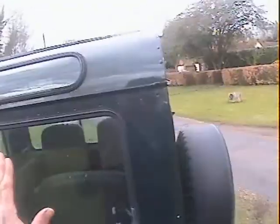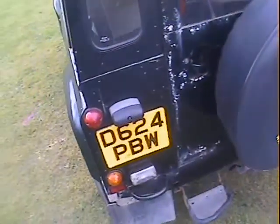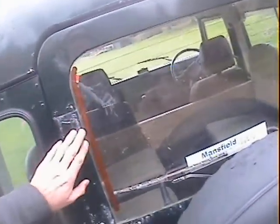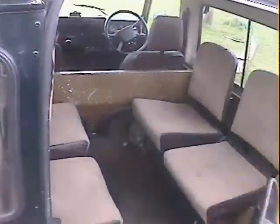That's just some mud — we've just gone through a puddle. The near side rear wing has quite a bit of lacquer loss, and up here around the tail end the cross member looks okay. It's actually quite nice underneath this one by the look of it. The tailgate has suffered the usual electrolytic reaction all the way down and around the latch. Inside at the back there are twin LPG tanks — one under there, one under there — it's quite a nice installation and doesn't impinge upon the space too much. The tailgate itself is actually very good on this one.